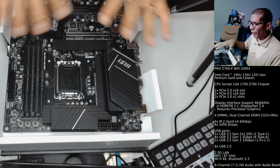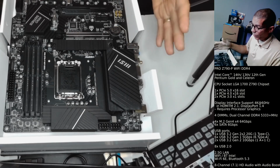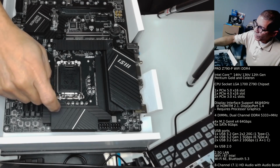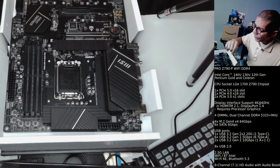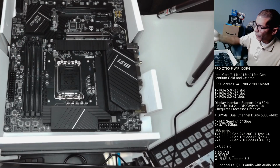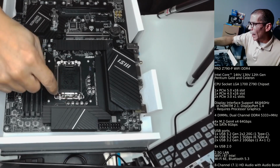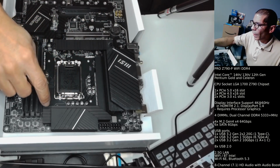Also, by doing this discovery, just by looking at it without looking at the website or the instruction manual, you actually see what capabilities your motherboard has. Like for example, these metal pieces here, aluminum, they're painted black with a little bit of decor and slots here and there. That's pretty much for heat dissipation. You have here voltage regulators, for lack of a better word, that feed the CPU and of course the rest of the components, and that's gonna get hot.